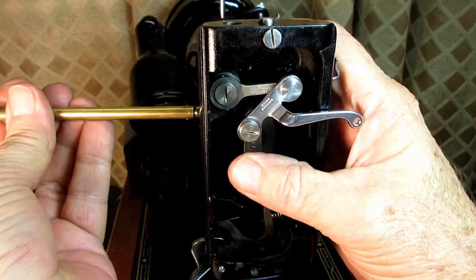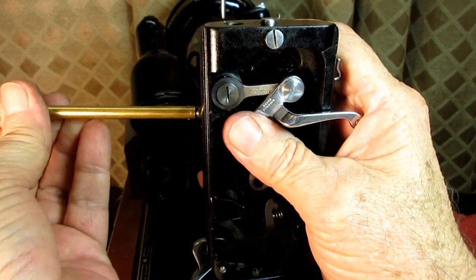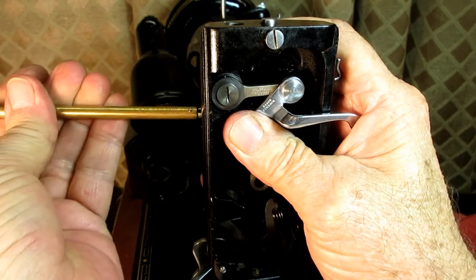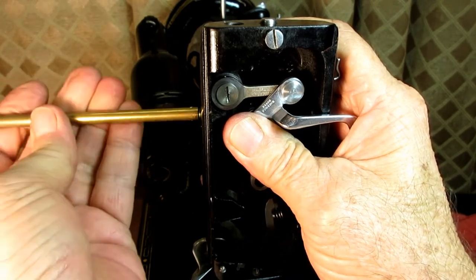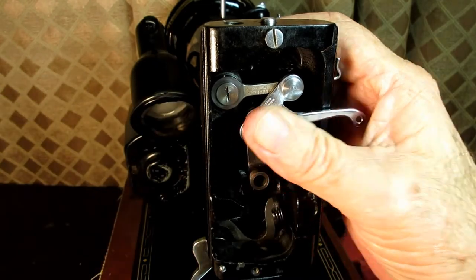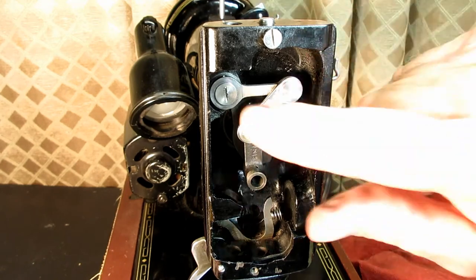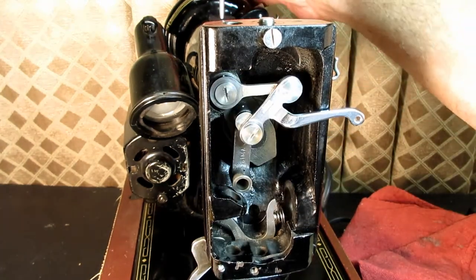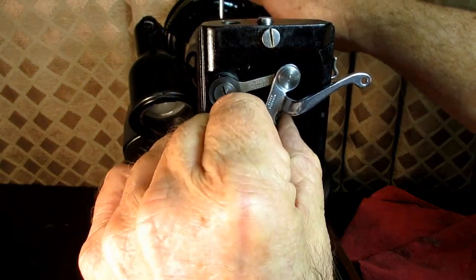And then with my thumb, I'm going to push hard on that stud to push it all the way against the counterbalance when I tighten it, because there cannot be any play there. Do not want any play there. And there's no adjustment to be made there. The adjustment is all up on this stud. So I'll just try that. Make sure that's good in there.